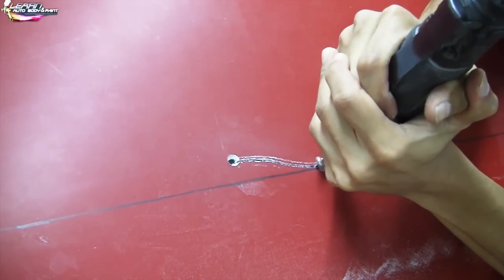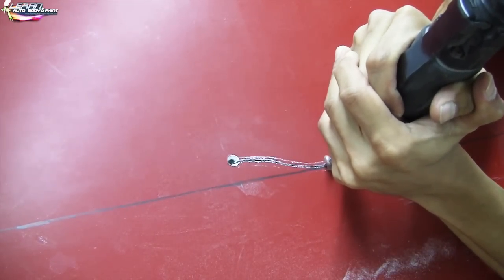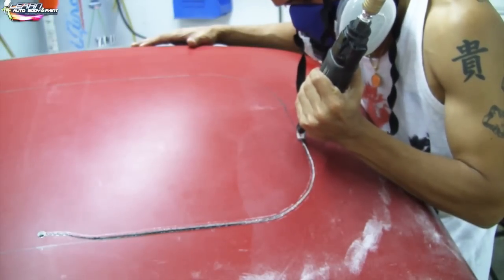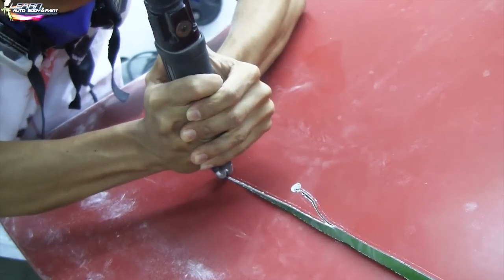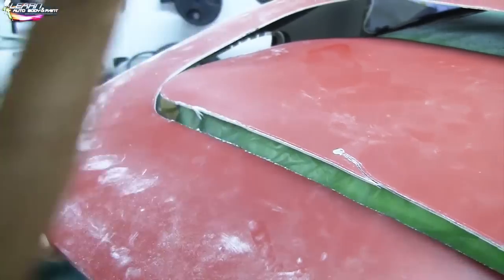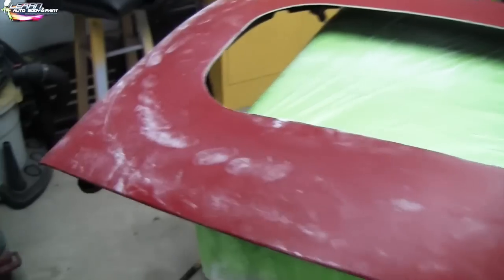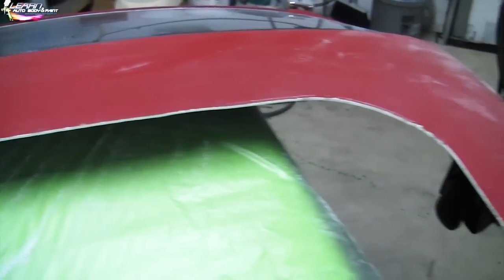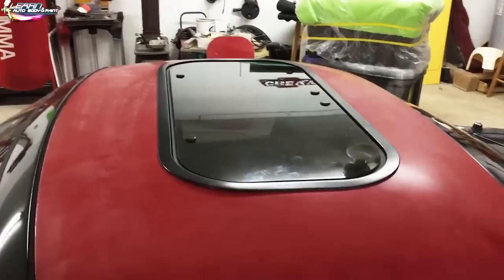Okay, and this is fiberglass, so it was pretty easy for me. If you're doing a regular roof, I did this on a 67 Camaro once, and it's the same process, you're just gonna use a metal tip. All right, so we just pull it off. Pretty simple process. It basically holds on like a sandwich. So you put a water sealant, like a weather stripping glue.